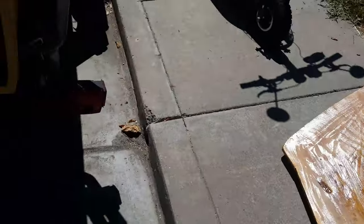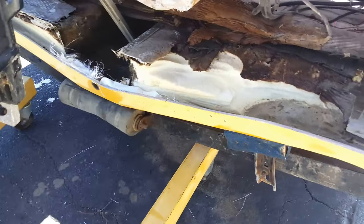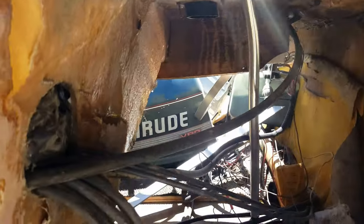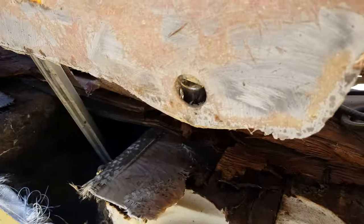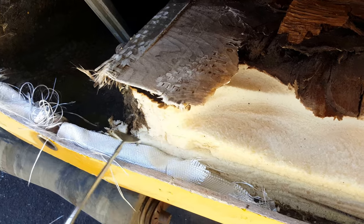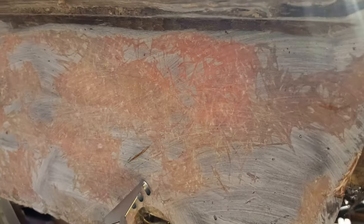All right, here's part two of the prep. They're ready to set the panel in place. I've got the trough cleaned and ground back. I'm gonna fiberglass it up in here — put a piece of mat across the back panel, then stick the board in the trough, filling it up with resin first.